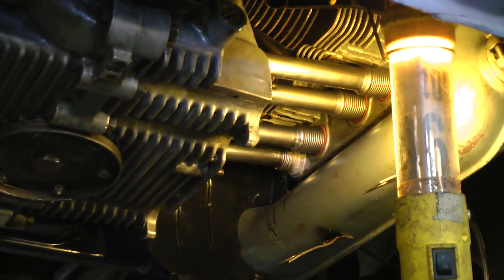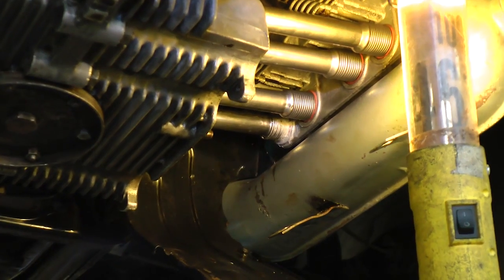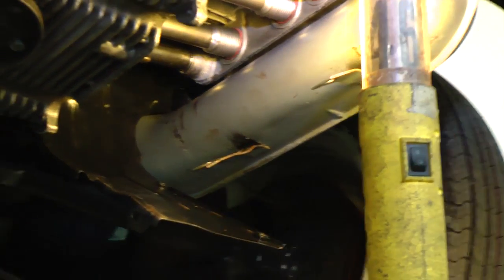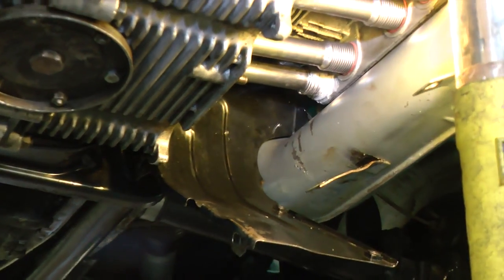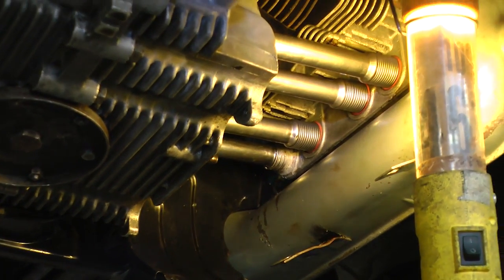And in general, if you don't have the means to take the motor out, you'd hate to give it to somebody to do, because it's going to be costly. So what I had to do is unbolt the tin here that covers the pushrod tubes, that's bolted to the heat box and bolted to the motor. Well, it's screwed in, really, not bolted. They have engine tin screws that hold that tin in, and we just pulled it down so we had access to that back tube. And that's what we did.